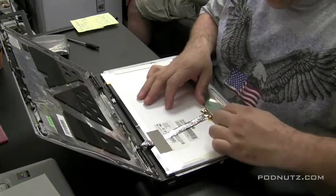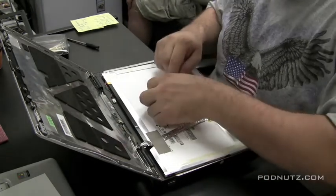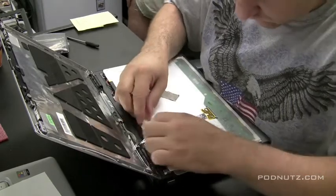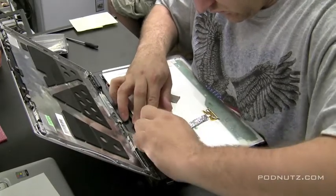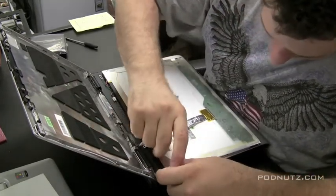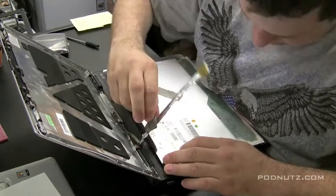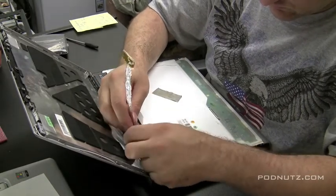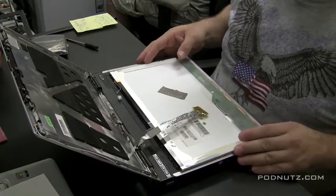Expose the LED cable and the connector. I got the tape off there — I'm going to get this tape off too, just so we have some give on the LCD cable. We don't want to damage the LCD cable; the screen we care less about right now. The LCD cable has about 30 or 40 little tiny wires in it that we don't want to mess up. And that pops right out — the LCD cable either pops right out, or sometimes there are two little locks you have to squeeze on the side to get it out. We're going to keep that LCD cable out of the way for now.